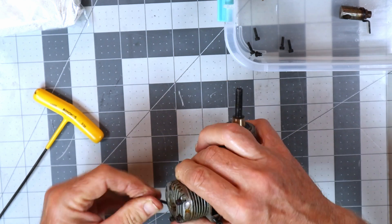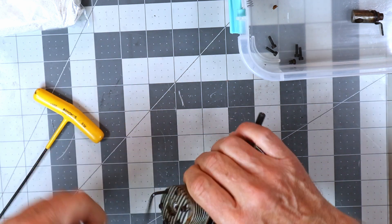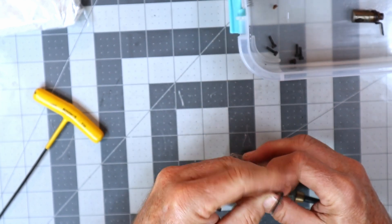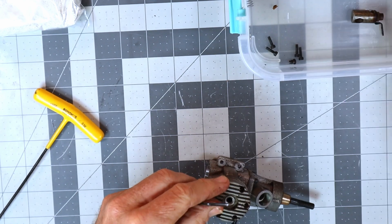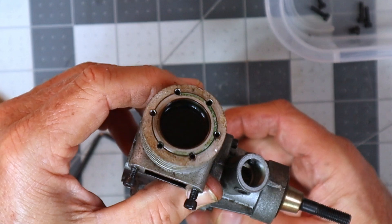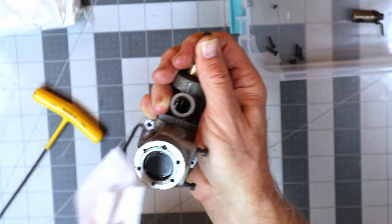As I was looking more closely at the side of the piston, maybe we'll see it when I get it out, it's got quite a bit of carbon buildup on the side - like this had a lot more than just a couple of runs. Unless it was just set super rich or something. Wow - looking at the piston now, it's completely black. That's just a black-top piston, but holy crap, look at that carbon. This engine has got a lot more run time on it than I thought.